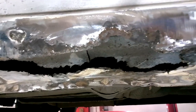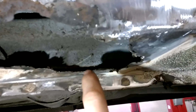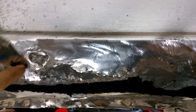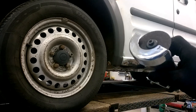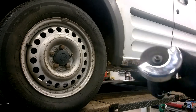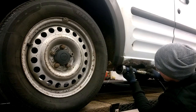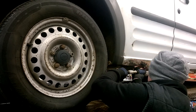As you can see, a lot more cleaning has been done. Going to cut this section out down here, all the way along and up along here, and then across there — that is the plate area we'll be replacing. I will be using this air cut-off tool, a three-and-a-half inch disc grinder, to start the cuts.